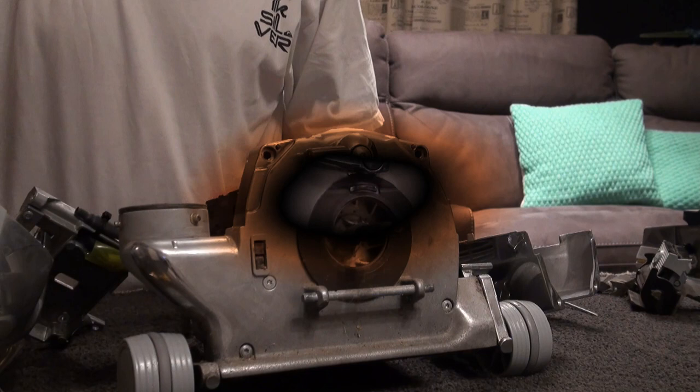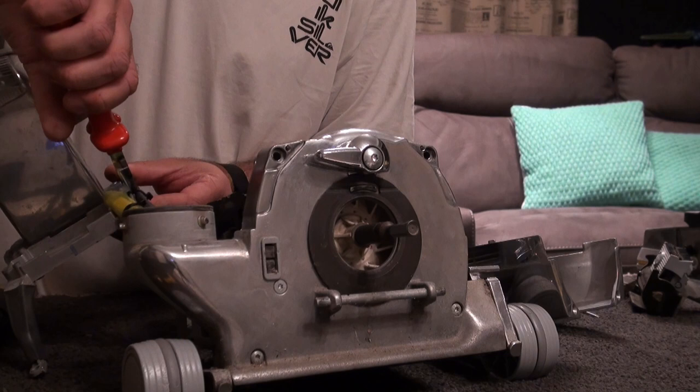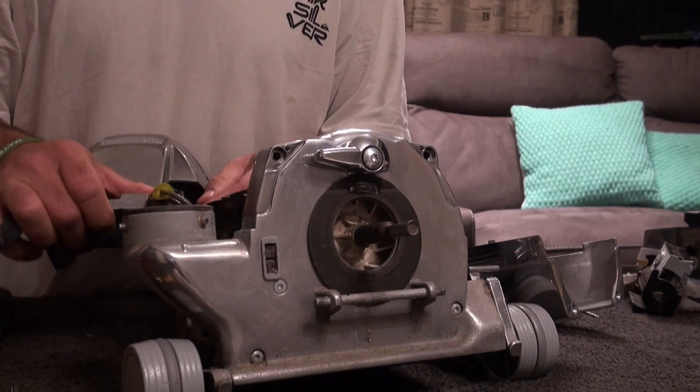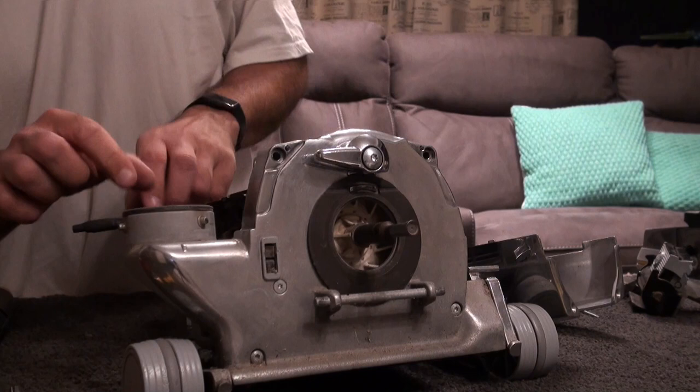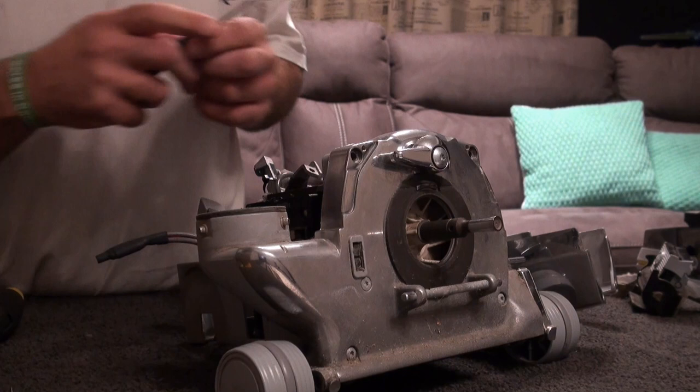All right, so to take this headlight assembly off, what we've got here is a bit of a looped wire. To make life easier, we'll snap this cable tie, and then we'll put a new one on after. So it's just cable toward there. Just makes life a bit easier. Now what you've got is your second part for your bulb, which is all in the bottom. Now it's easier to just take these connections off first, and then you can release that for your bulb. So, all right. Let's grab that screwdriver. Okay.